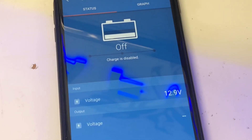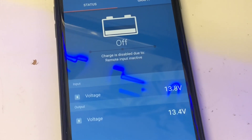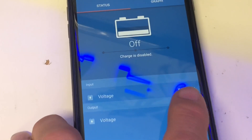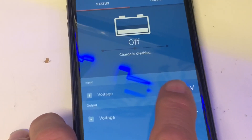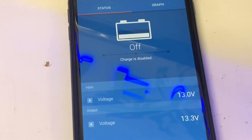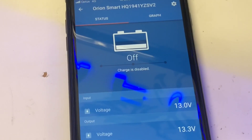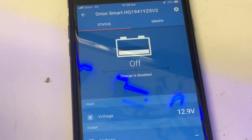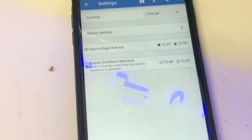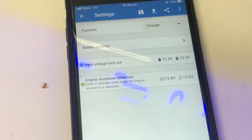We can keep winding the voltage up. If I had enough power in my power supply — I'm at 14.2, 14.3 now — it would just come on and stay on all the time. That top voltage is the alternator running voltage. The bottom voltage for it to turn off is the voltage after you start the car when the ignition first comes on — specifically when the alternator is running, not just ignition on. Set that as the bottom part of the shutdown, and make the top part 0.3 to 0.4 volts above that.